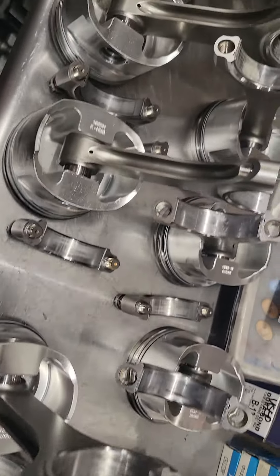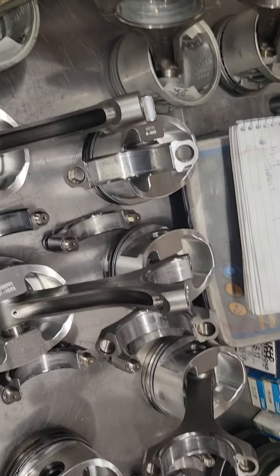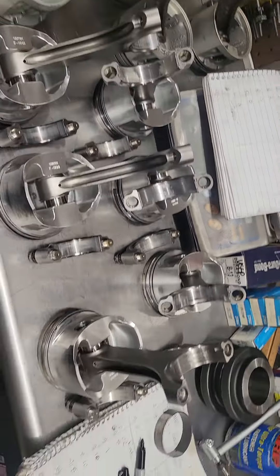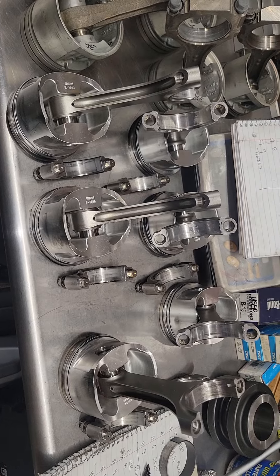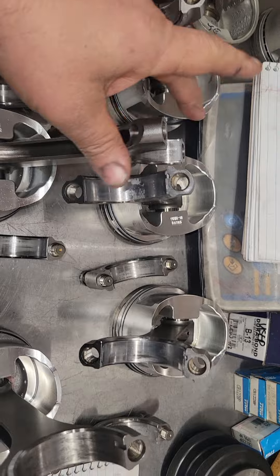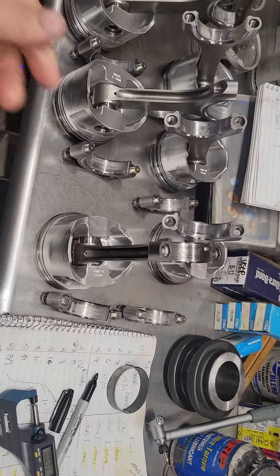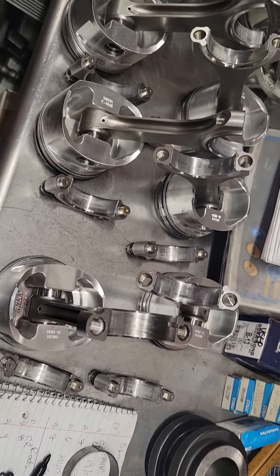That really didn't make a whole lot of difference. The thing about the H bearing versus the P bearing is the P bearing has better embeddability, but the H bearing is stronger and more resistant to detonation. So I'm counting on you not detonating it, Brandon. Hopefully we wouldn't have had as much trash go through it if we hadn't had stock head gaskets. Now we have Cometics, so if we get trash, something's come apart. I'm going to mic these up and see where the numbers come out — I expect they'll be very close.